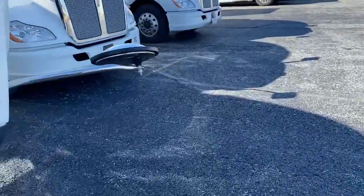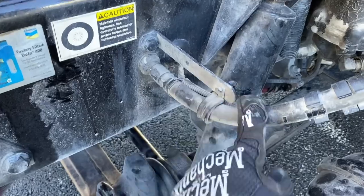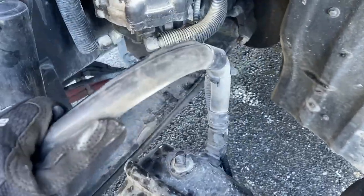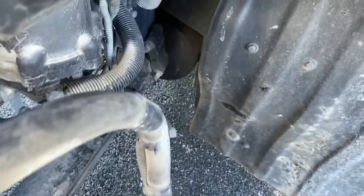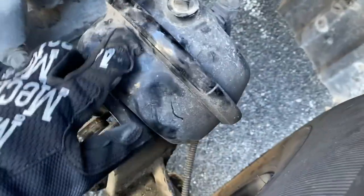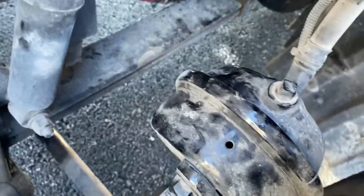Let's start working on the tire system, which I'm actually going to start with the braking system — starting with the hoses since they come off the frame. The hoses are not ripped, cut, torn, or frayed, they're clamped securely, no visible leaks on the hoses. That brings me to the brake chamber — not cracked, bent, or broken, it is securely mounted, no bolts are missing, the clamp is secure, and there are no visible leaks on the brake chamber.